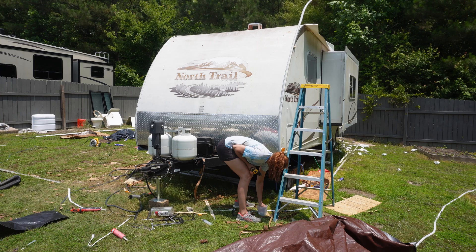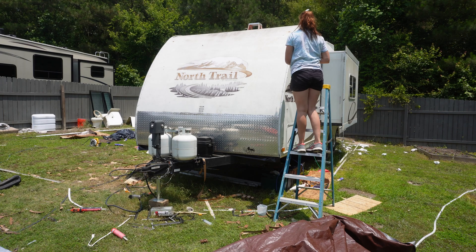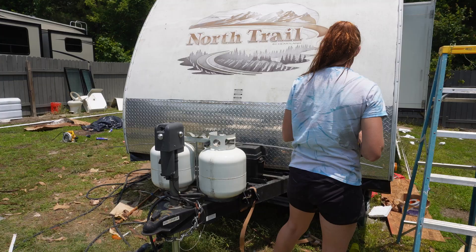Same thing on the other side — put the butyl tape down, line it up, and start putting the screws in. I had to order some screw trim covers, so that's why I'm not getting to the sealant today. Hopefully that stuff will come in tomorrow. I didn't put the screws all the way up at the roof yet — I'll go up to the roof side to make sure it's aligned properly. Side note: this is a terrible place for my ladder because I've almost fallen off it four times.